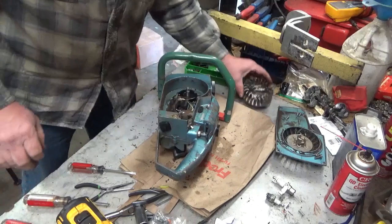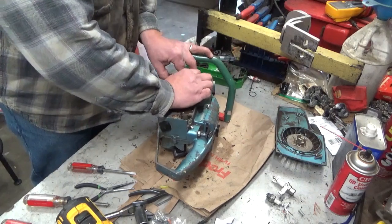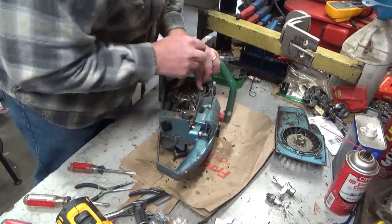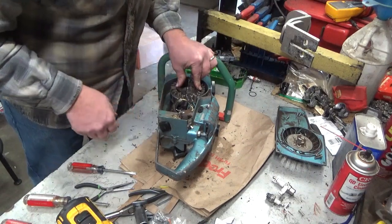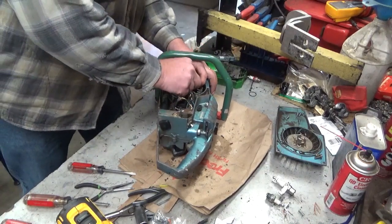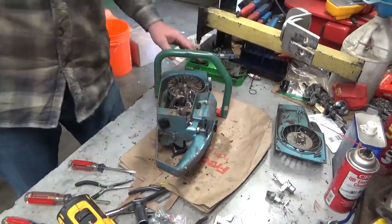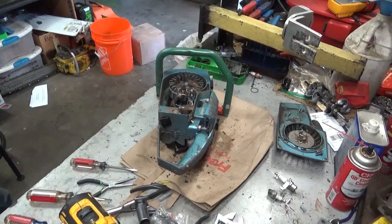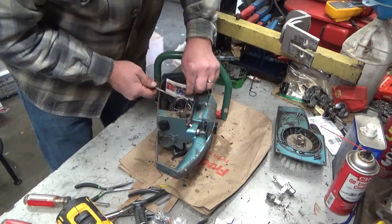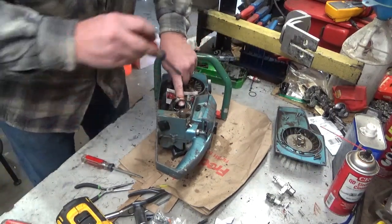Alright, we'll leave that coil loose so that we can set our flywheel gap. And hopefully that's the last time I have to screw with that. Where the hell did that nut go? Right there still. Get trusty flywheel gap setter here. Never failed me. Until the paper gets torn up and I have to replace it, but you know, that's beside the point.